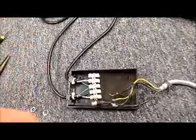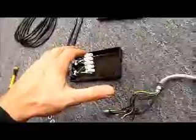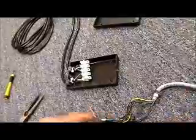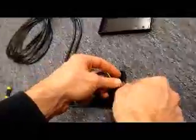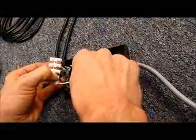Once you've got that one done, you're going to reconnect the cord the same way. Now we've got our newly disconnected black junction box and power cord assembly, and the gray lamp cord coming off our fixture. First thing to do is slide the little grommet in here, then take and connect the fan adapter and slide it through the hole.